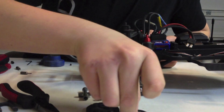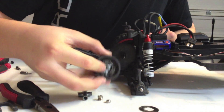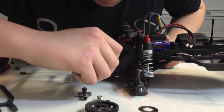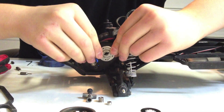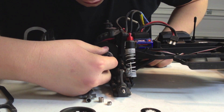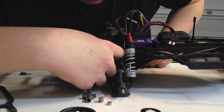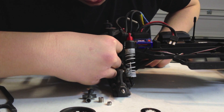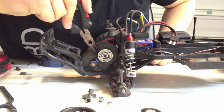When you're assembling your slipper clutch — like if you just burnt out your slipper clutch and burnt out part of your pads — you can go ahead and put the steel pin inside the two holes. Once you've gotten this pin in, you can see there are little indentions where the pin is going to slide in. Go ahead and try to line that up. Your pin might fall out, so be careful when you're moving this because the pin tries to slip out. You can also get your needle nose pliers in there and just move it around a little so it's right.